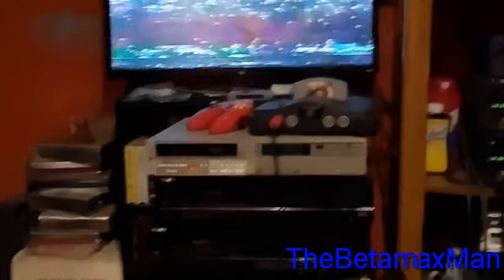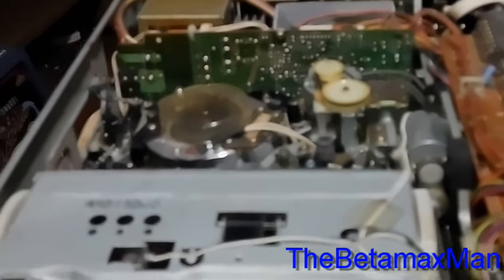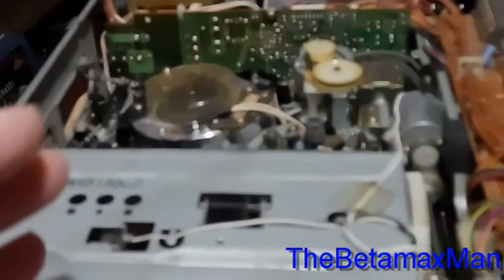It could be something in the pulse generator as well. You'll notice you can hear that jumping around. If we put it on monaural, you can hear the audio without any issues, and that tells me the caps and servo circuitry are fine — it's the drum servo. This is recorded in hi-fi stereo, which is recorded with the video heads. If the video head is not working correctly, it can cause the type of symptom we're seeing here.